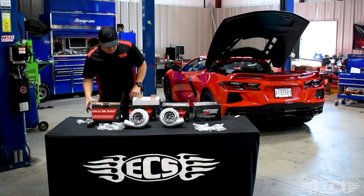One option that comes to mind is just ripping the rear muffler off and putting the turbos back there. We've seen a couple of guys do that, and it's a decent setup. However, one of the main concerns I have with that is the fact that your turbochargers are after the catalytic converter. When the catalytic converter goes, that could leave chunks going through your turbocharger — obviously not ideal. Also, having a catalytic converter in front of your turbo creates a lot of flow restriction, turbulence, and heat — none of which are beneficial to spooling up efficiently. So we decided to go with a more traditional setup with a turbo manifold, keeping everything as close to the engine as possible and routing everything to the back as far as exhaust. We feel that is the best setup for this car.